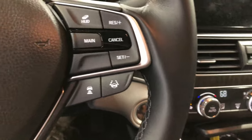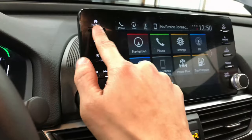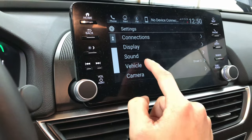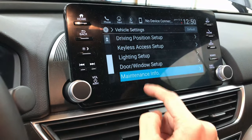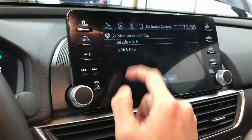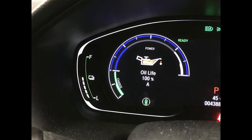Next, I jumped into the car and just turned it on. I'm going to show you how to reset the maintenance light if you have one on right now. From the center console, you're going to hit the home button, then go to settings, vehicle, maintenance info, select reset items. I like this menu because you could choose the tire rotation and some other things that you don't get on the steering wheel. I didn't find the steering wheel control as intuitive, so I'm not including it in this video.